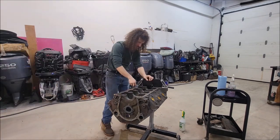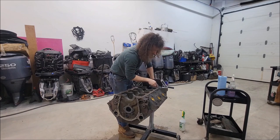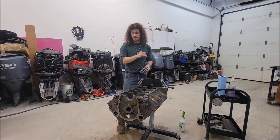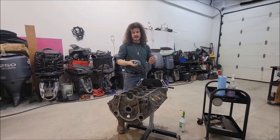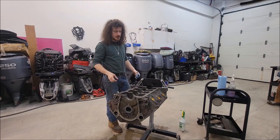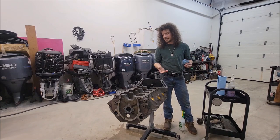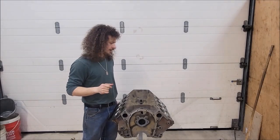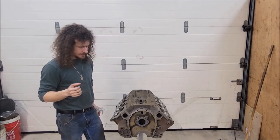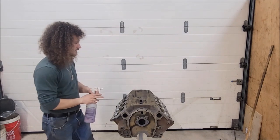Still going to try and dry off some of those hard-to-reach places. There is some stuff in the cylinder walls, so I'm going to give this another shot and use a little more high-pressure water, standing closer to the door to try and keep it contained. This block is actually cleaner than I expected — they do wash these at the machine shop, I imagine pretty well. But it's always nice to do things yourself, then you know. Next step is hit it with Spray 9 again, then higher pressure water, dry the block, and use some compressed air.